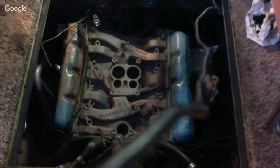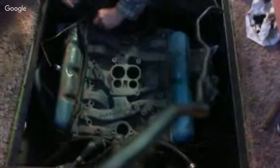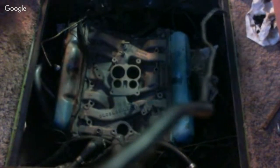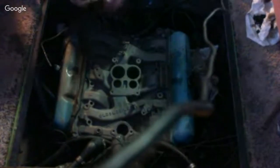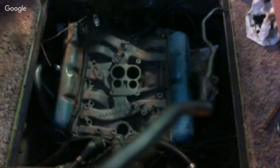You'll remember the nipple that the water hose went to? It was here. The top of it was rusted over half off. I couldn't find a complete brass one, but we got a brass into a steel. I've got to take it in the shop, put thread tape on it, tighten this down, and then I'm going to put some Teflon tape again on here and screw that in permanently, and that'll take care of that.